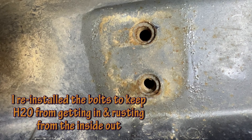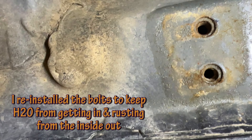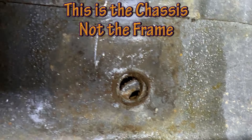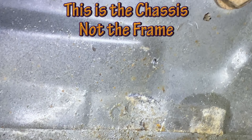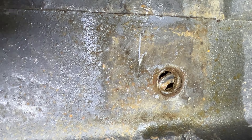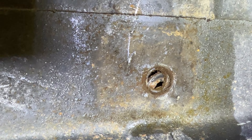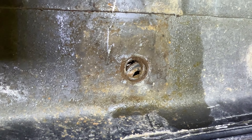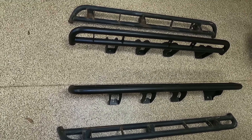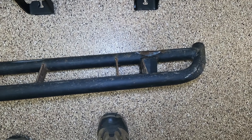The driver's side slider is off. That's the middle mount there — minimal rust, but anti-seize would have helped me out. Over here at the front, the rivnut which is inside busted loose, so it was essentially stripped. But I wedged it and pried on it and it finally came free — that was a bitch. And I've got the aftermarket sliders off. I hosed them down, and there's that rock that came down pretty hard on it.